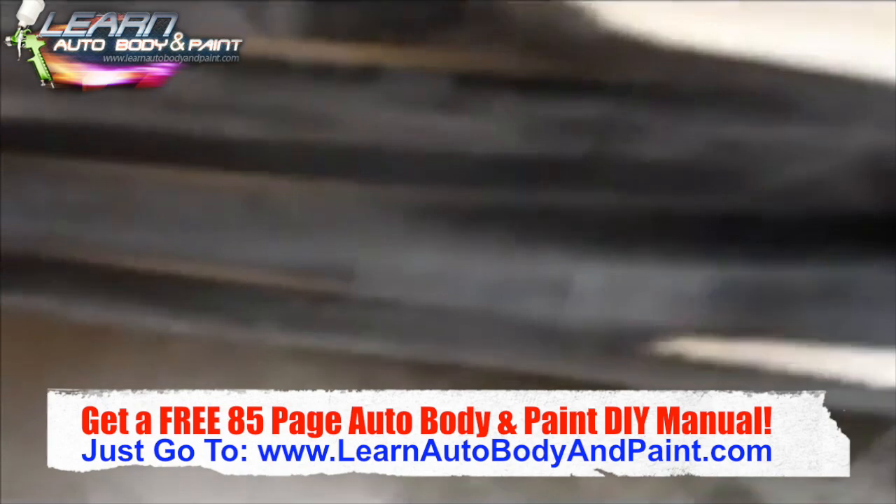The rest of this body kit in here we're not really going to deal with because it feels good — doesn't feel ripply or anything. Up in here we're all done. Up in this other area we have a low spot. I got the DA and went around, and this is low because the DA was hitting out here and hitting the Bondo. So we're going to add one skin coat here and a little bit right in this corner because she's a little low — we're just going to build it up a little more on this corner.